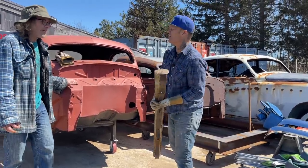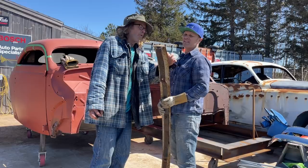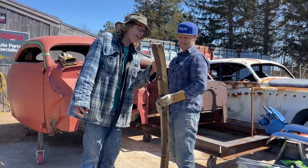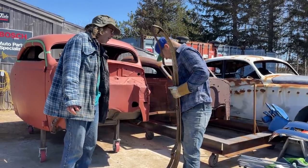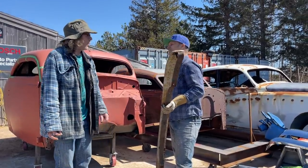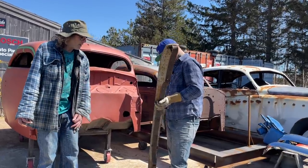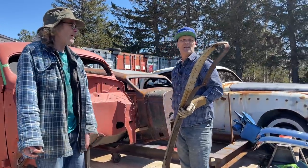One thing about grinding is you get these little pits out, which sandblasting wouldn't. You'd have to sandblast in the seam. But what would you do when you put your sticky stuff on? Just fill that in with body filler? Probably wouldn't even do anything with it. The sticky stuff would stick there. It depends on how wide your strips are that you put on.